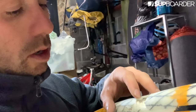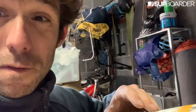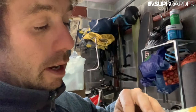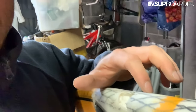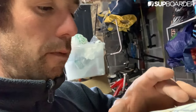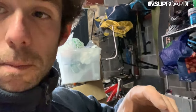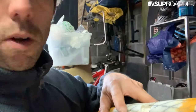then I'll probably build the rest of the shape up with that and put my first layer of 200 GSM bi-directional glass on, I think. And I'll probably do a couple of layers of that, actually. I'll taper out the edges to make sure that when I sand it, I'm not just going to take away all the material. So it needs probably a couple of circular oval pieces covering the repair, both tapered out. So one smaller, one bigger oval type shape.